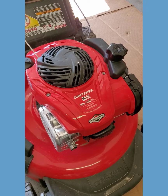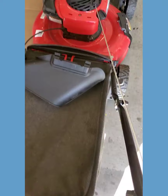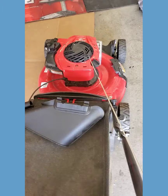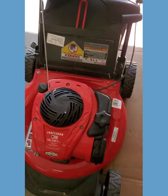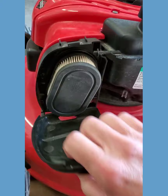This video is on the Craftsman M110 140cc little push mower. Got this one for a song, and now I know why — it doesn't start. It's pretty much brand new but it's got the dreaded pull-no-start condition. These are supposed to be guaranteed to start within two pulls. Doesn't happen. No prime, no choke, just pull for power. Doesn't work.